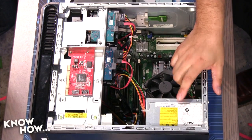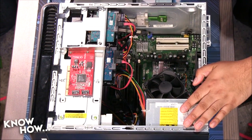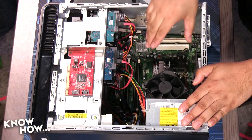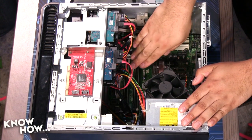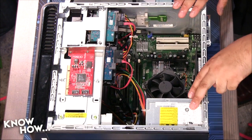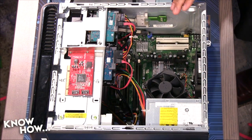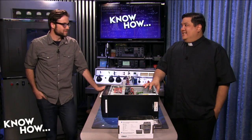It's okay. Now, here's actually a big one, and we didn't cover this last time. Power supply. You don't want that to die. Don't cheap out on the power supply. You know how many times I've seen FreeNAS boxes where they've bought really good drives, a great motherboard, a really solid ECC error-correcting memory, a powerful CPU, and then they bought the bargain basement $15 400-watt power supply. The one that's going to burn out when you least want it to.